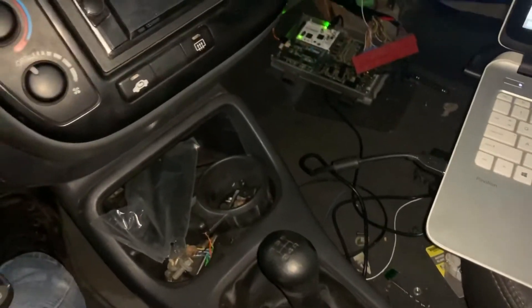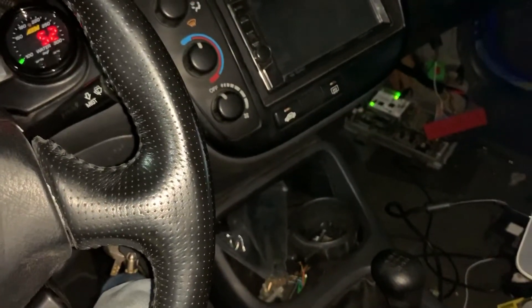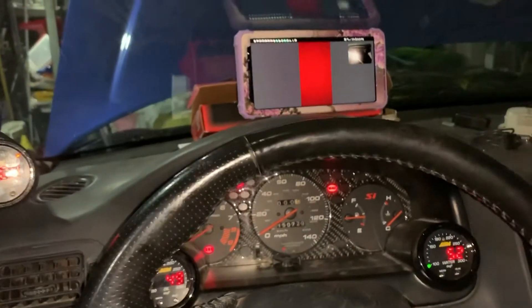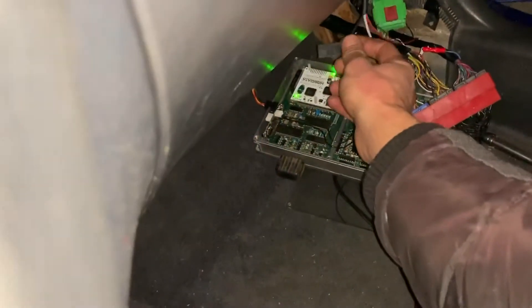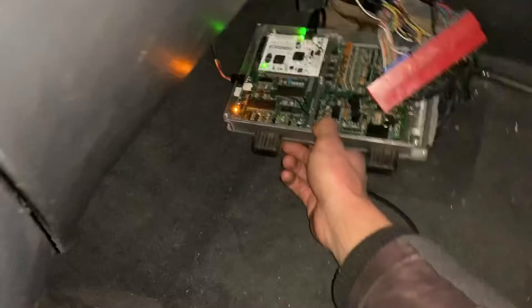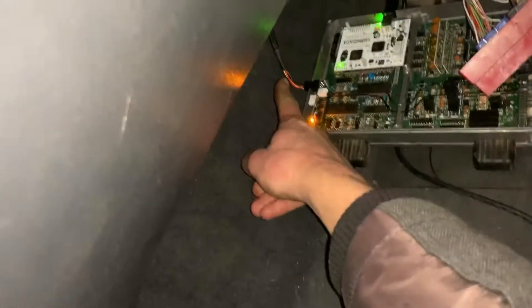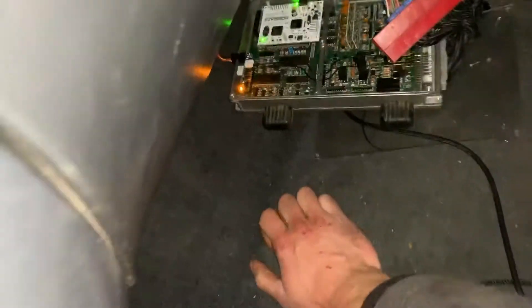I'm probably gonna have to look into this. Why didn't Travis come over and look for the problem? Because it just now didn't start — he's not a time traveler. I just realized I don't have my ethanol sensor thing plugged in at all. I don't really think I need it plugged in. I made everything so short — this mounts when the ECU is in the right spot. This is the coil-on-plug harness — I shortened that a lot too. I'll plug that in and think about this some more.